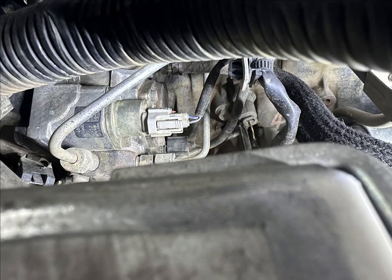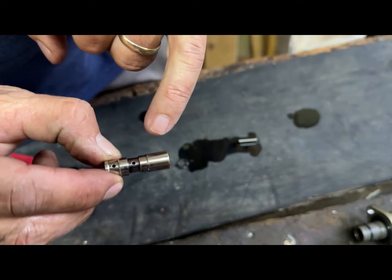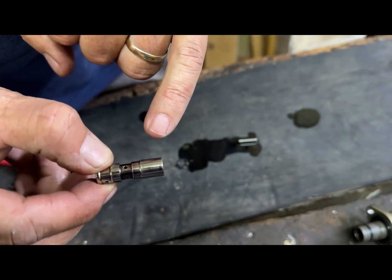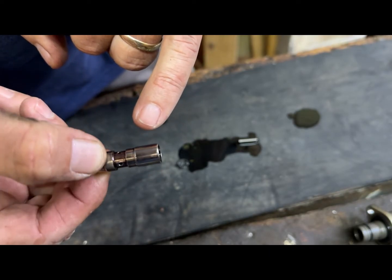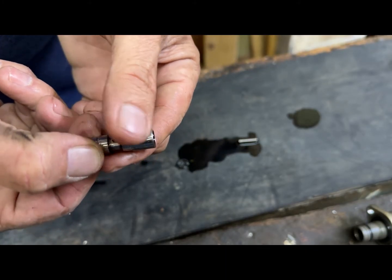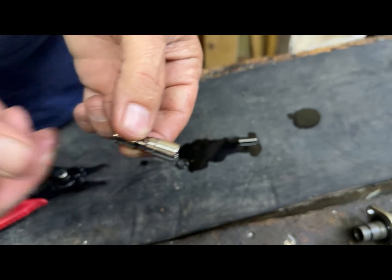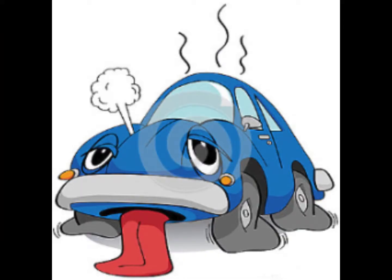You can imagine that this causes the piston to scour over time on one side of the piston, as gravity forces the piston to be nearer to the bottom side of the sleeve than the top side. When the piston is scoured, the operation cannot be smooth anymore, and common symptoms such as engine surging and the engine going into limp mode arise.